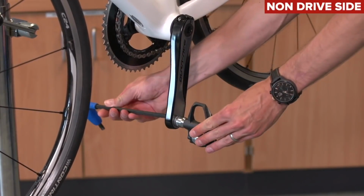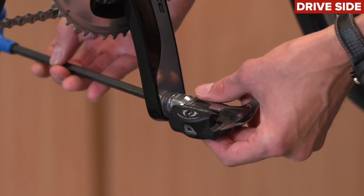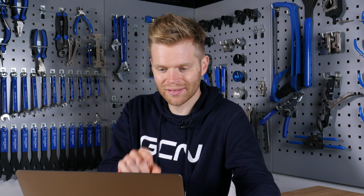I mean, it's a good fact actually, on the first bikes, people's left-hand pedals kept on unscrewing. So this is back in like Victorian times, 1800s. They had to work out that they needed to put a left-hand thread on the left-hand pedal to stop it unwinding as people rode it. Crazy. Anyhow, most pedals have a 9/16 inch by 20 threads per inch thread.